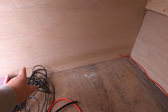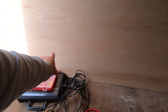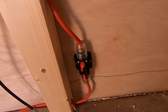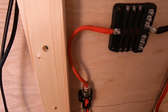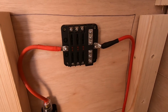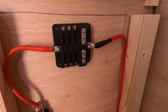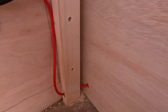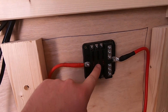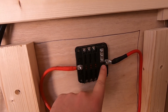Right, so we now have a 10mm live coming from the leisure battery under the seat, coming around and into a 50 amp breaker. From that 50 amp breaker it goes up into the live side of the fuse box. And a 10mm cable coming from the fuse box — the earth — running through and into the wheel arch. That's what I've done at the start. So there's your lives, that's where your blade fuses go, that's your live side, and there's your earths.